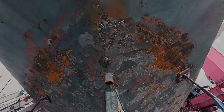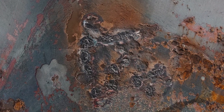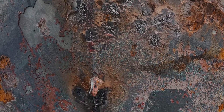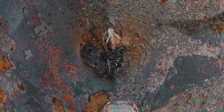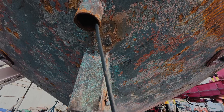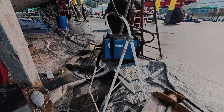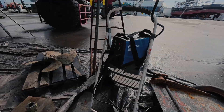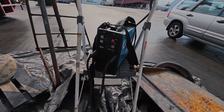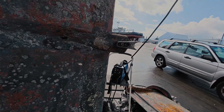We've got some blue sky for a change. Here's another area that I've already started on before it got dark, and then we had a big rainy spell, so I need to come back and finish. I'm really just focusing on thickening the thin spots in the hull with stick welding. Here's my Miller Maxstar 161S welder — it's doing a great job running on 220-volt power.